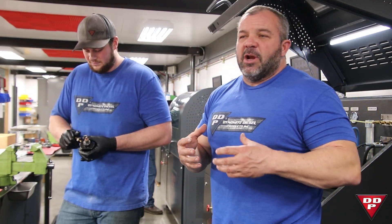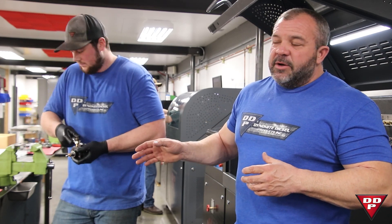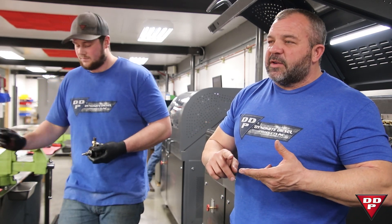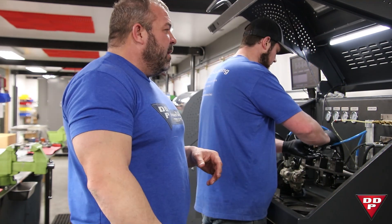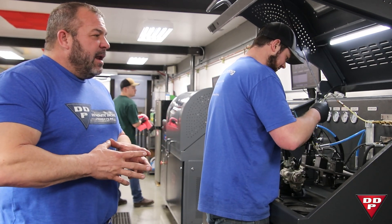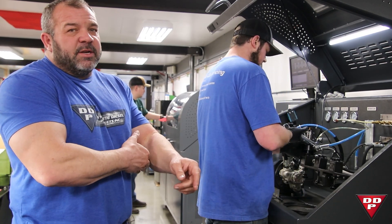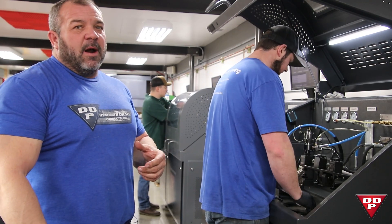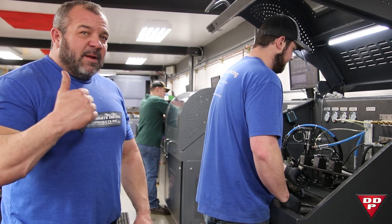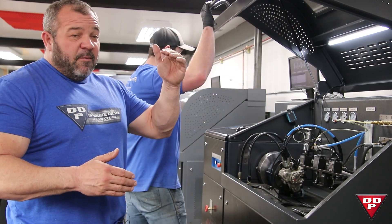So a brand spanking new Bosch injector for all the 325 horse trucks. We're going to run this thing with stock parameters, and then just to show you what a Bully Dog GT Tuner, an Edge Box, or CanTuner.com actually does. Remember, quantity burnt is actually what makes horsepower. Smoke is not making horsepower — that's just unburnt fuel, it's wasted. You have to burn whatever you're shoving in the cylinder, and you've only got so much piston compression time before it goes away.